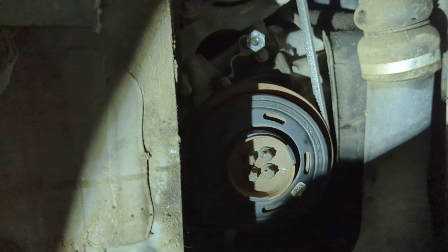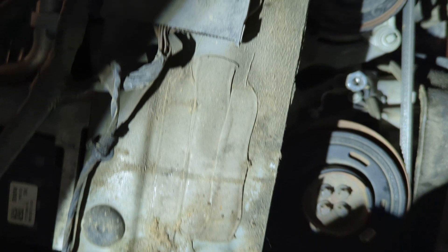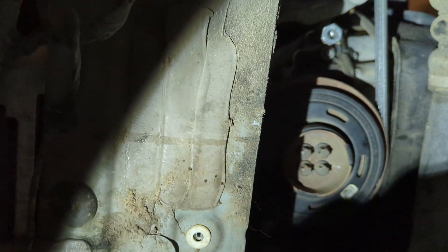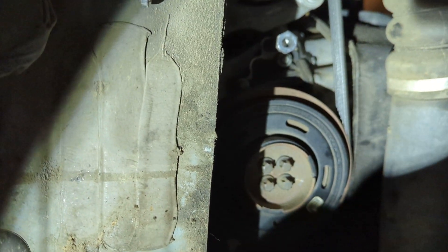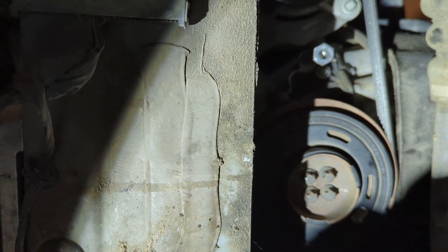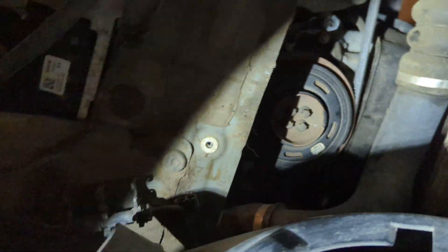So that's the issue with this 2015 Mini Cooper — overheating and battery voltage not working. The reason is that the water pump isn't turning to circulate coolant, and the alternator isn't spinning to charge the battery.